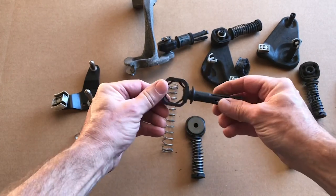Specifically on the MQB cars — that's the Mark 7, Mark 8, and newer — the whole cabin shifter assembly is plastic and the upper loop has a step in it, which has caused some confusion. Because of that step, it can be helpful to guide the pin in at an angle, pass it through, and then once you align the stick appropriately, it'll drop into the box. We've had customers think the pin was too big, but that's not the case — the injection-molded socket has four ribs when new, which can make it feel like the pin doesn't want to drop in. If you get it all lined up, it will just drop right in. Now our cabin shifter is locked and our selector shaft is locked.